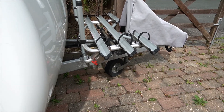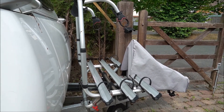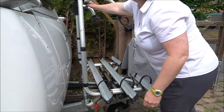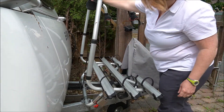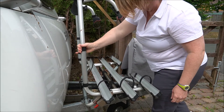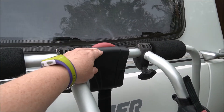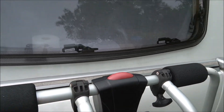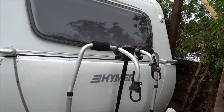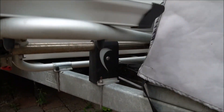So a summary — what do I think? The best points: this thing has done thousands of miles and not a single bolt has come loose or moved. It's all nylock nuts so we didn't have to use any thread glue. It's super easy to load and unload, which makes taking bikes along easy even for those of us who are very short. When the carrier first arrived I did think it felt a bit flimsy compared to chunkier two-inch stuff, but it's been absolutely fine, so I was reassured about that.